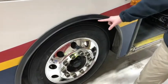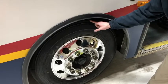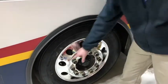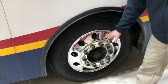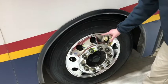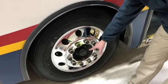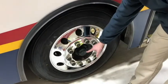For the tire: the tire tread is evenly worn. There are no cuts or separations, and the tread is at least 4/32nds of an inch deep. The tire walls are free of abrasion, bumps or cuts. I would check the tire inflation here. The tire rims are free of dents, cracks or bends. There are no welding repairs. The valve cap and stem are not damaged, broken or missing. The hub and axle seal is not leaking. And if there were a sight glass, I could check the lubricant level there.